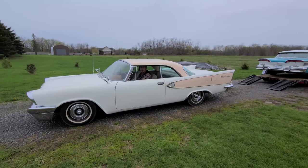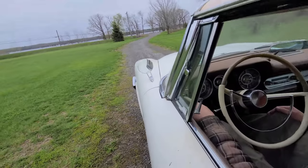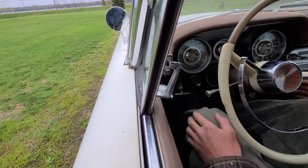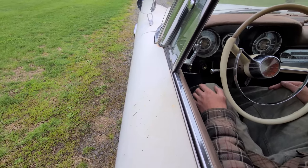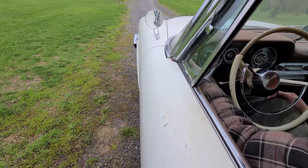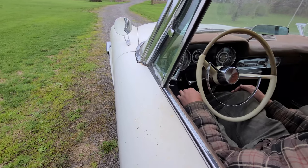The interesting part is I don't know how to put it in neutral without shutting it off, because neutral is the start button. So if you press it into neutral, the starter zings. Just try and lightly push it. I've done it, and then you hear zing off the ring gear. So to put it in neutral, I'll do this, and it pops into neutral. And then if I turn the key back on, it starts up and runs.